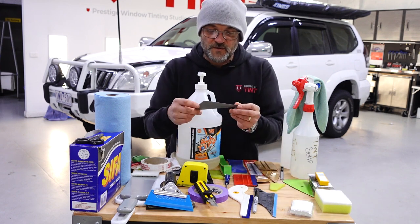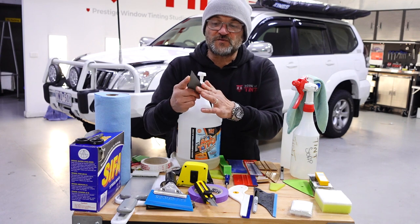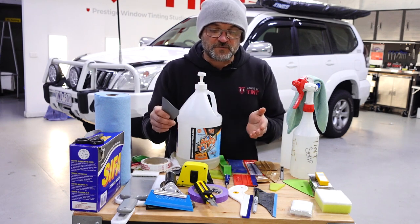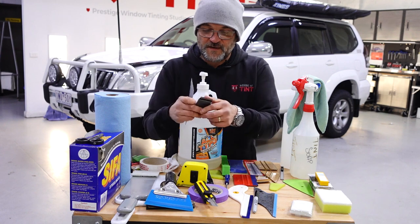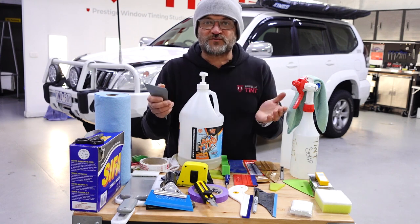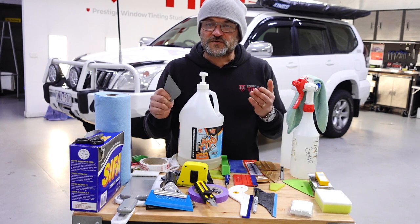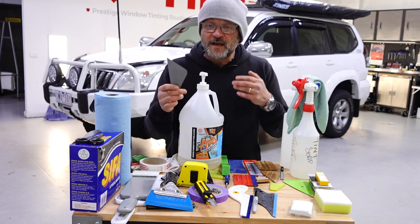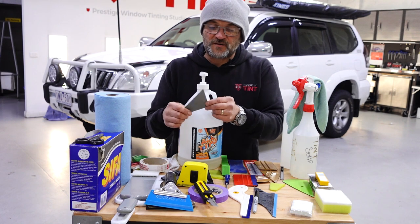Another amazing tool to put in your kit is what they call an Easy Reach Platinum. Very, very good — you just need to keep them sanded as they do scratch, so be careful. You can also use the shorter end. I use it for European cars where you don't want to put a scraper on the glass. We scrape windows clean with a scraper and I always use stainless blades for that. For European cars you want to use a plastic scraper because they tend to scratch, especially Range Rovers or anything with Triple-X on the bottom of the glass. The glass is very soft, and there are also import cars — I know Toyota have a couple — where there's a coating on the inside of the glass. If you put a blade on it you'll just destroy it. So educate yourself on those vehicles — anything European or Japanese imports may have a coating on the glass and you'll need a plastic scraper.